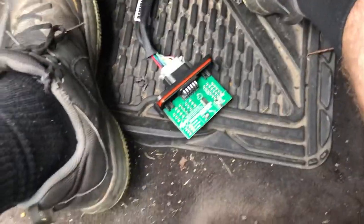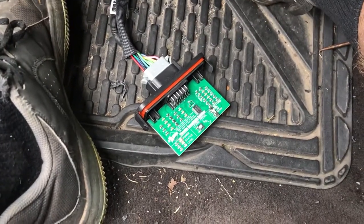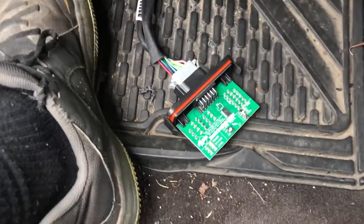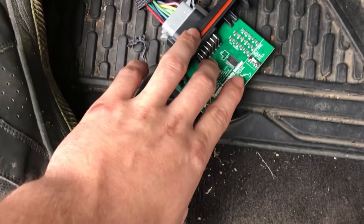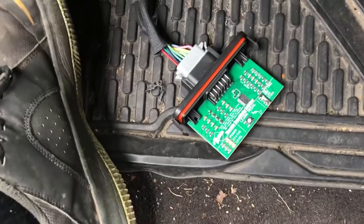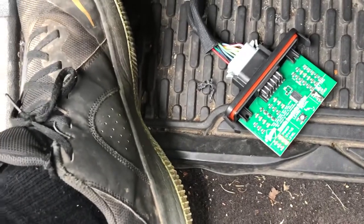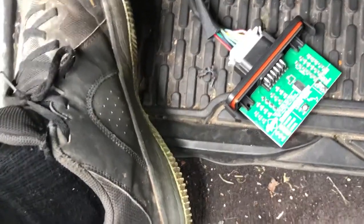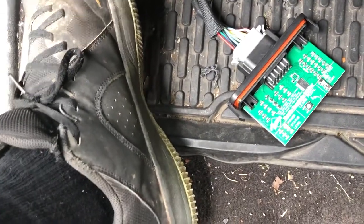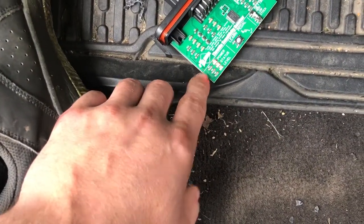Turn the key on. We've got power. Okay, so status. We're going to make it learn, so we're going to hit this learn button. You see level, push in, out, push in, out, push in, out, in, out, about 15 seconds. And your vehicle should relearn itself in status. Once your status light is blinking, which that one is, you guys are good to go.